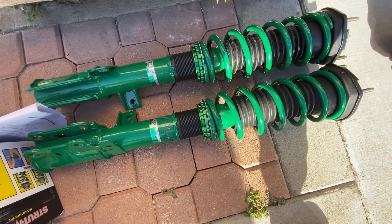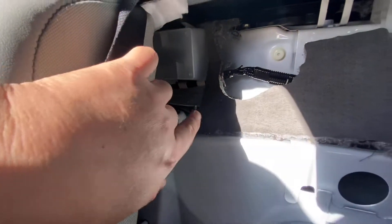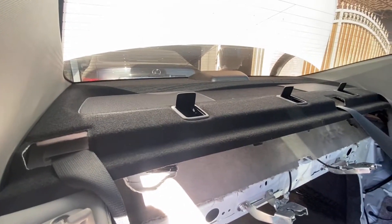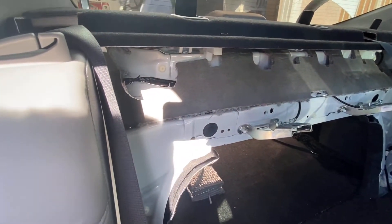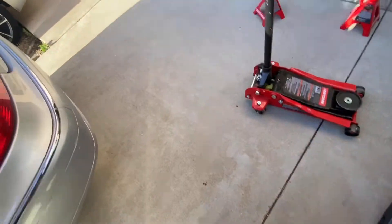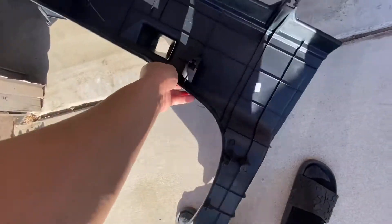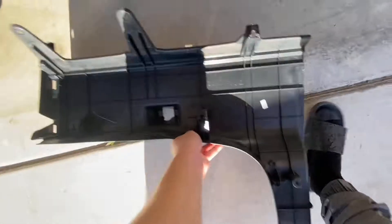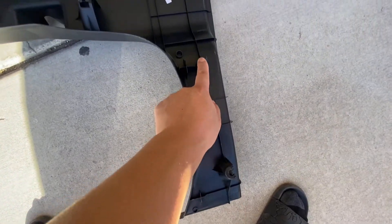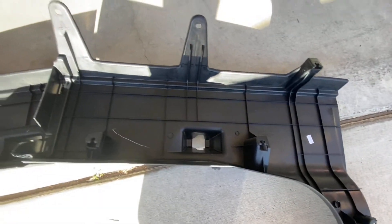The front's already on, but now we have the rear. You get the top of the strut here with the three bolts. You have to take off these panels on the back of the seat — not the speaker cover, just the panels. You have to get there from underneath the trunk. These are the basic clips that hold the panels in place.